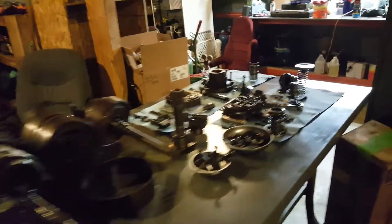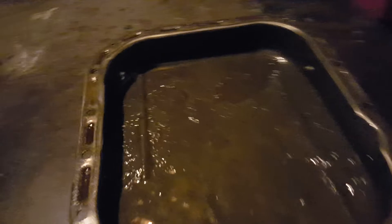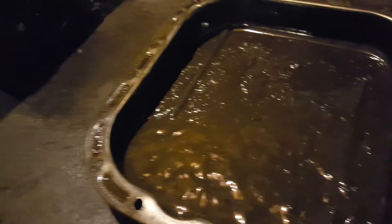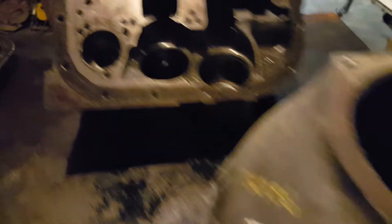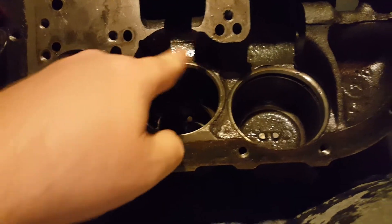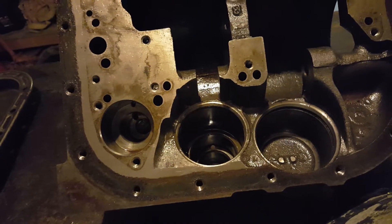Here's the update — transmission is torn apart. My dad's been hard at it, you can tell by his dirty shirt. That's one reason why we took it apart. The transmission pan looks horrible; we're thinking it's original with no real signs of any replacement. There's your TorqueFlite cast iron — they call it something like 877 — got it torn apart. There's a new used bell housing because the old one was cracked. Dad had to take the bands out through here, and there are the levers for the band servos.